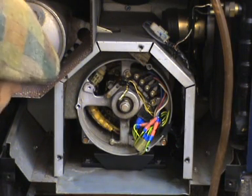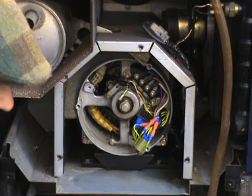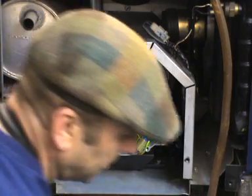If you were getting 20 ohms, or one ohm or something, then you've definitely got a problem with the rotor. But round about 60 ohms, 80 ohms — that's fine. There's no problem with that motor.